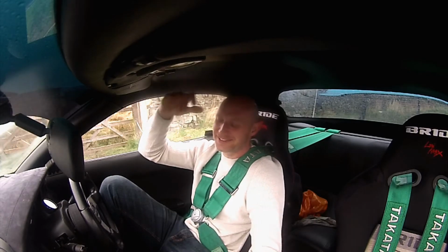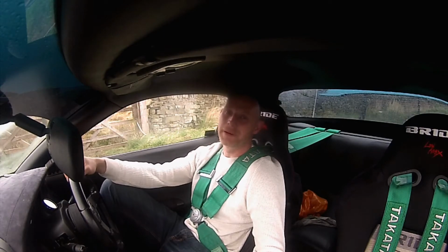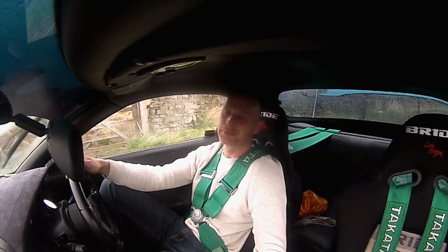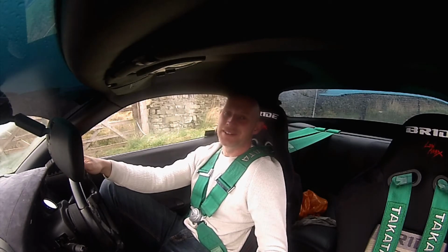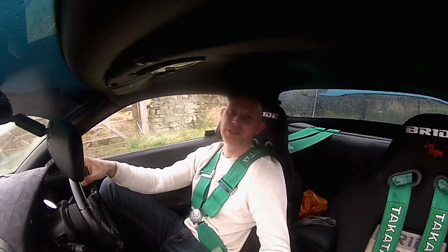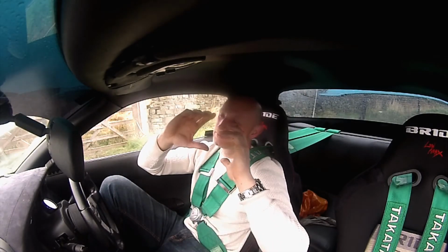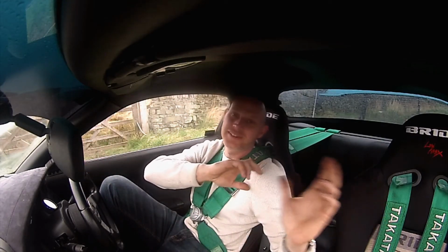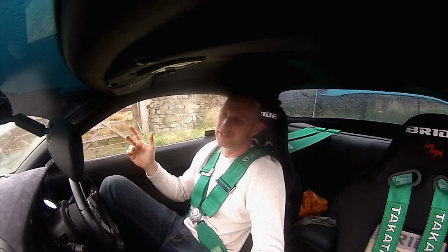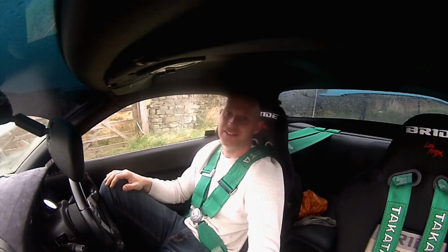Another thing that I want to do to the car so bad, the REMMU kit, the ADGT front bumper, has a few little things in there that's incredible, right? Like, they really did think about it when they made that bumper. One of the things that they've got is dedicated brake vent pipe ducting built into them. So you can literally get your 6cm tube, slot it on, run your duct in, zip tie it wherever you need to zip tie it, run it right to your brakes and cool them down, and I haven't done it yet. I mean, it is a $40 mod to get brake cooling in there.